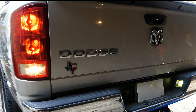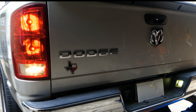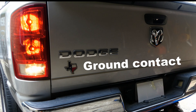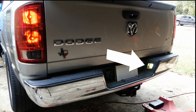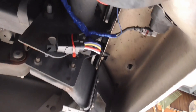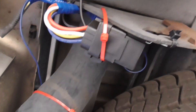The transmission is in reverse but the license plate lights are still on. Looks like I didn't have a great ground, so I'll try to find a better one. Now the reverse lights are on and the license plate lights went out just as intended. Since the testing passed, I went ahead and wrapped up the connections. This is a temporary job so I can drive it around for a few weeks for further testing. If everything works out I'll check the securement, and if something needs to be changed I can change it then.